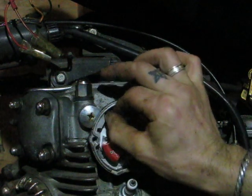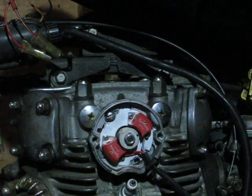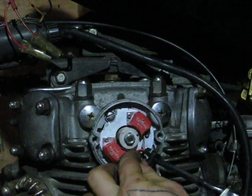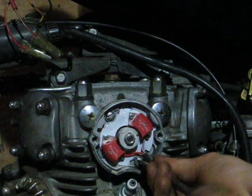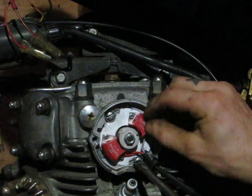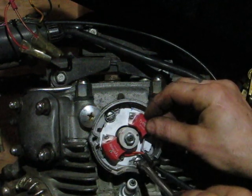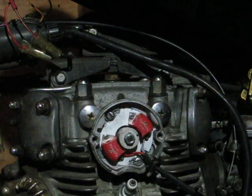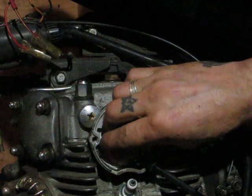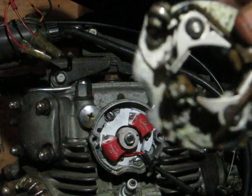But it makes it a little bit of a pain when you try to slide the plate to do your timing adjustment. So go ahead and reinstall your 2 flathead screws with their washers. And I noticed one guy on the forum mentioned he didn't like that this only had half slots where the bolts hold it down, but maybe he hasn't examined the points plate, because that's the exact same way the points plates are.